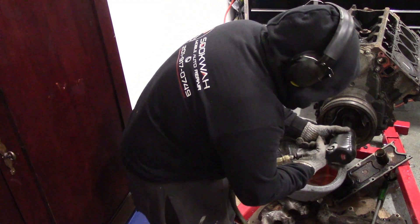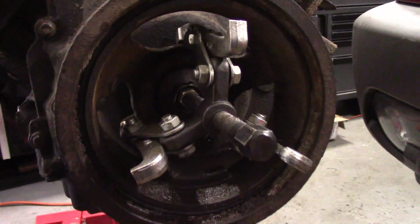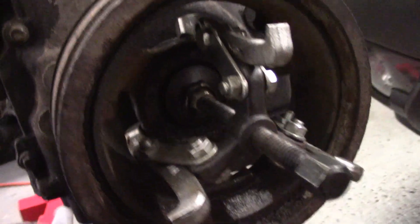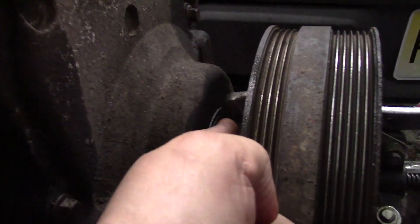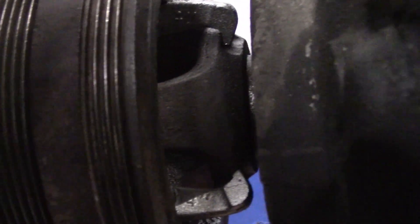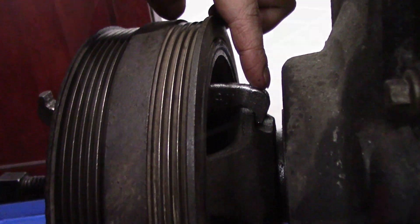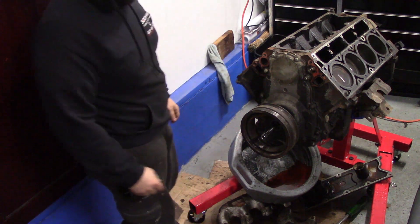To remove our crank pulley, there's a 24 millimeter bolt that needs to be removed in order to remove our front cover. I install my crank pulley remover tool — this is called a three-jaw puller, link will be in the description below. Each jaw clamps onto a dip on the crank pulley. I use a three-eighths extension in place of the crank bolt so the bolt has something to press against while the jaw pulls the crank out. I use a 17 millimeter socket to assist my puller tool to remove the crank.